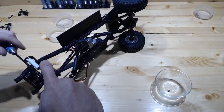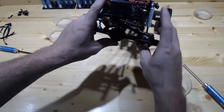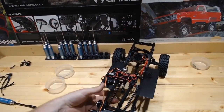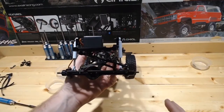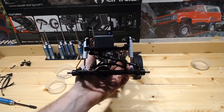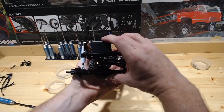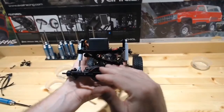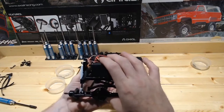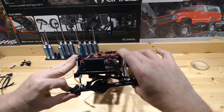Now we'll be good. So that is a 2mm spacer that I added on top of the steering arm. There's a 20 second delay or so between me actually talking and me being able to see it on my screen. But yeah, that looks good. Hopefully you guys can see that everything lines up and is level. The links don't have to be parallel to the axle upon suspension compression — just want them parallel with each other. That's definitely more travel than I had just with the leaf springs. That is pretty easy to max out the shocks.